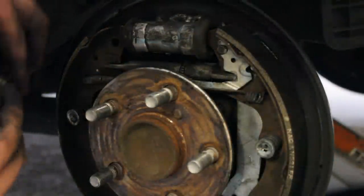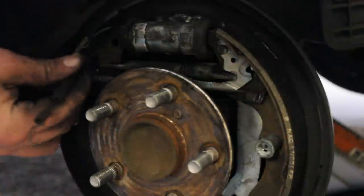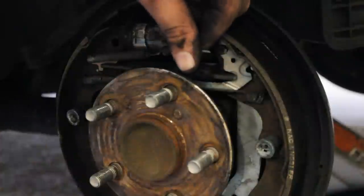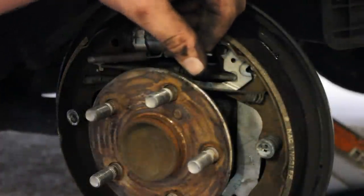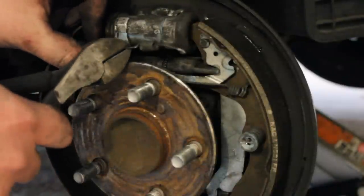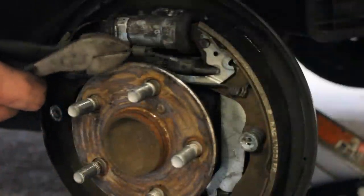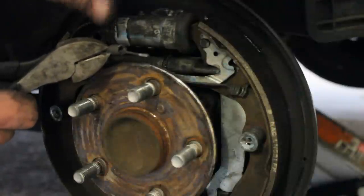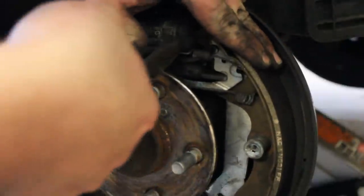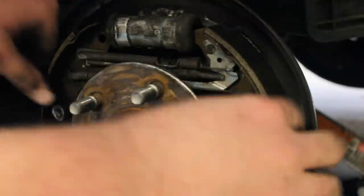The next thing we're doing is putting this spring back on. Remember your little shim guy here — we're going to stick him in and then go back in that little spot right there and get him hooked up so it's sitting and looks like that. Then I'll take my dykes and grab this spring right here — we're going to drop that spring right in there. Hold this shoe the whole while because this guy likes to slide back and forth up here and you don't want fluid spilling everywhere, which can happen. We'll just hook him right like that, and now our adjuster is all tight — nice and tight up there. We've just got the spring down below to hook up.